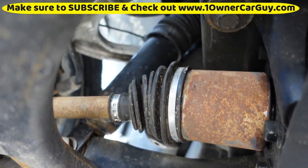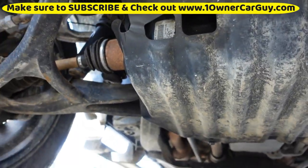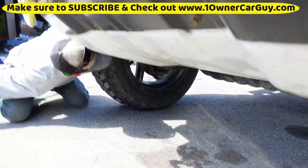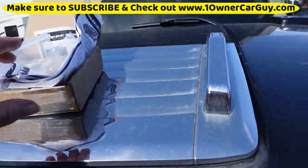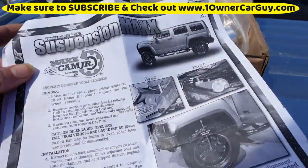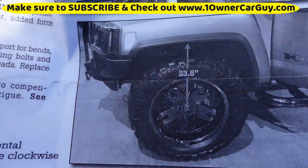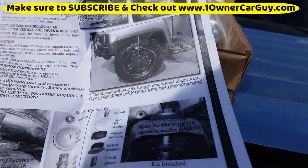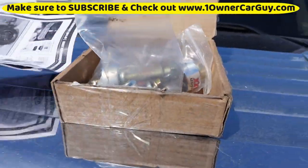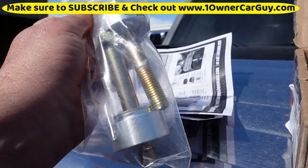It's a big angle, man. It goes da-da-da-da especially if you floor it. You're going to want to talk to Larry at Suspension Max — he's got this kit. 23.5 inch clearance from the hub to the top of the fender is all you can have. If you've got any more than that, you're absolutely going to need this. It's a cool little kit — it drops the differential down.